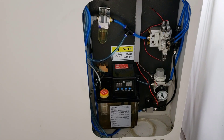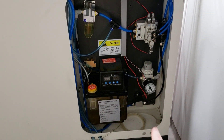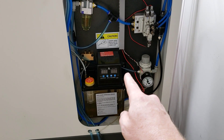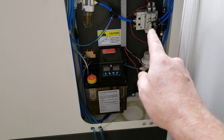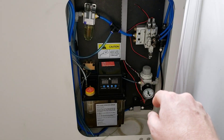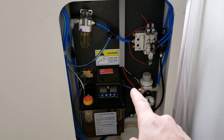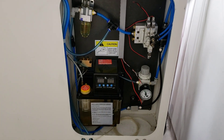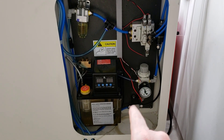So, how mine came — and how I believe a lot of them come — by default, is you go in through one of these two holes with a 5/16ths OD hose. It comes in and goes into this L. There's a manifold here of three ports. One port runs the gun. The second port comes up to this manifold, and out of this manifold you have a hose for the mister, and then the default and open/closed position of the ATC — that is to say when it's out to actually do a tool change. The third one goes off to the power draw bar, which has its own solenoids. It's all 5/16ths plumbed by default. In fact, this is all 5/16ths, and it does have one converter from 5/16ths to quarter that I reused.